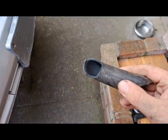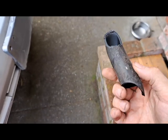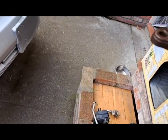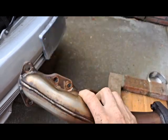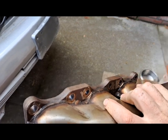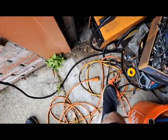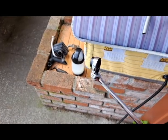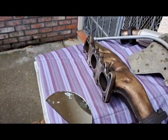All the rubber hoses in the area are cracked and fell apart — they're ancient and all need to be replaced. I took the part numbers directly off them; they're not too bad, about ten dollars each, and you need three. When it comes to the actual exhaust manifold, Lystrits is the name of the company — they're very high quality and easy to work with. They have a series of 12mm bolts holding them on, and they're pretty easy to get to. The bolts on the far ends at the bottom were difficult; I had to use a 12mm universal and a pivoting ratcheting 12mm wrench to reach the furthest bolt on the bottom edge.